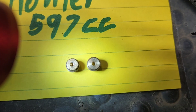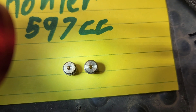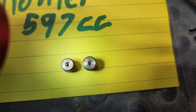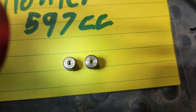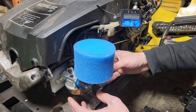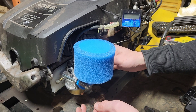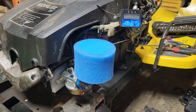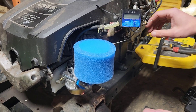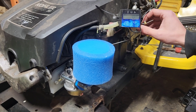I apologize for the weird lighting, but it's the only way I can manage to get the stock versus the 49 to show up. Big shout out to nrracing.com — when I first did the Duramax build for the Sears Dragster, they didn't make a 49, but now they do. We should have the idle set about a thousand or so, we'll see if it'll hold there. Choke should be off at this point. Let's see if it'll start.